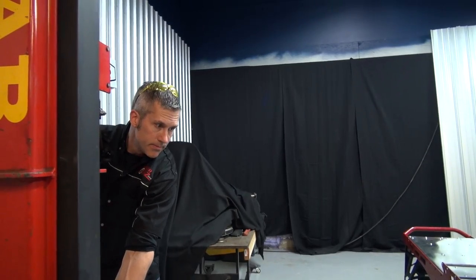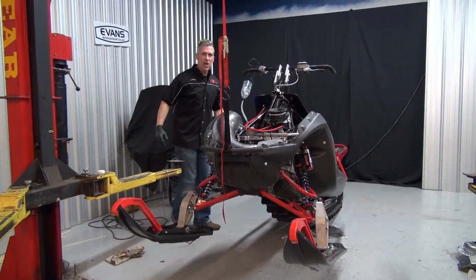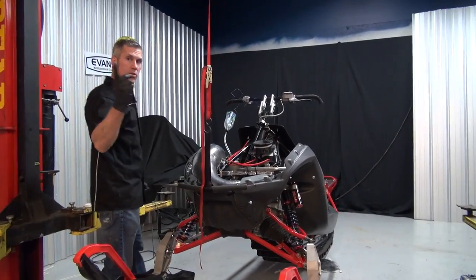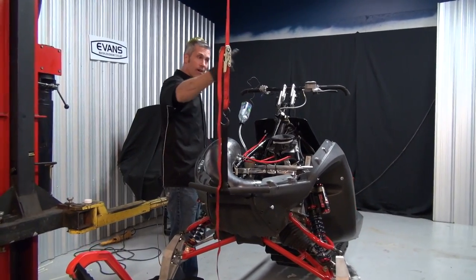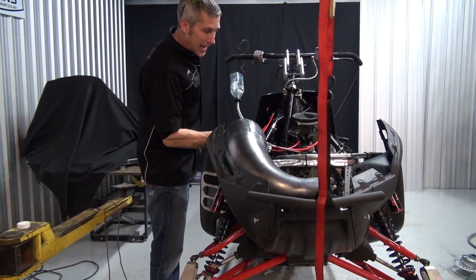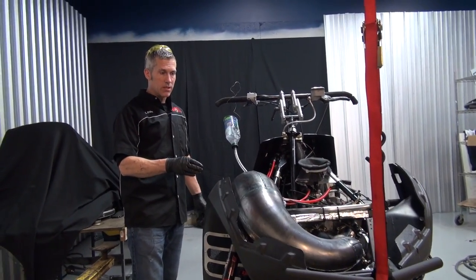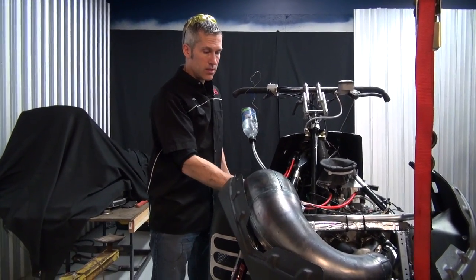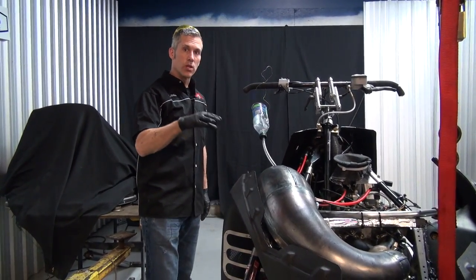She's such a good-looking sled. I've got that double pass cooler in the back — it's kind of like a U. So the fluid's got to go down and in and around and then back out and up the sides. It's got to get through those rails. Any portion of this snowmobile that is higher than this coolant bottle is gonna affect the way that the coolant goes in.